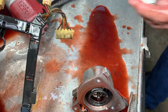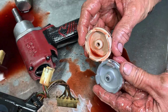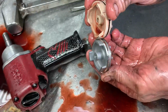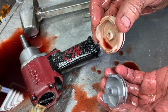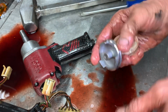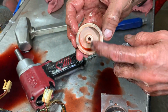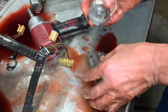And this here is our new piston we're going to be putting in there. You notice the support's a lot longer. Turn sideways? No, sorry. See it. Yeah, there you go. Okay. Keeps that piston from rocking. Seals it a lot better. See? Also, it'll shorten the stroke because it'll bottom out down here sooner than this one here. This one actually will touch here. So, it's the only way to go.